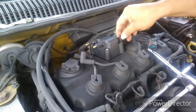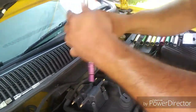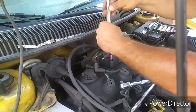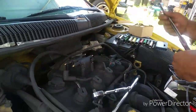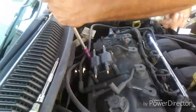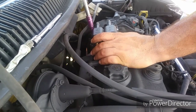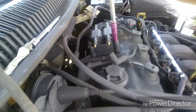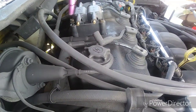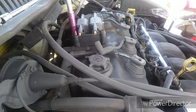Now we mount the coil pack the way it was — one, two, three, four, just like before. I like to get all my screws in before I start tightening down. At the end of this video I'll have the torque specs. Don't tighten all the way down on the first pass — you want to get them all just close to snug and work from one side across, alternating, rather than going around the circle, to make sure it bolts down evenly.